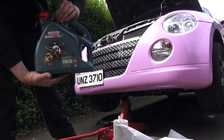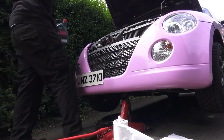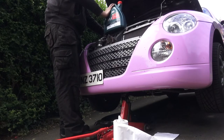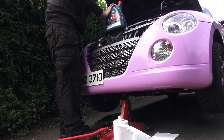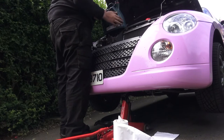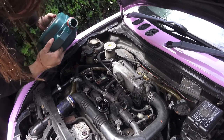The manual says about three litres of 10W-40 with the filter change. This is a four litre jug, so I should have around one litre left. I'll take it slowly. It's good at this point to give the oil cap a little smell for fuel, and also look for any sludge, because that could indicate a blown head gasket or something like that. But this one looks good. If you're smart you use a funnel — if you're lazy you just try and aim right.